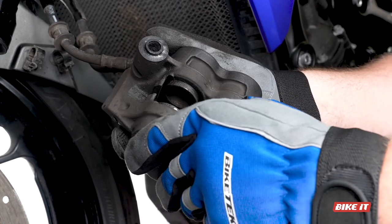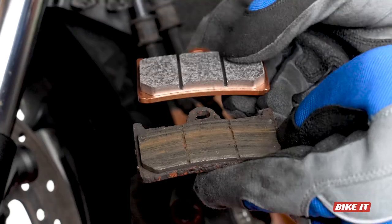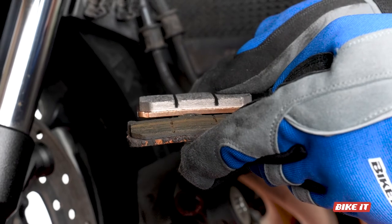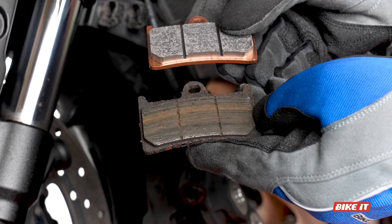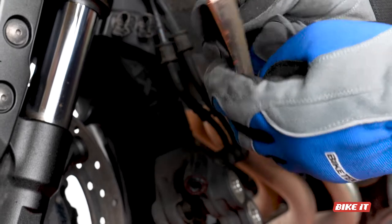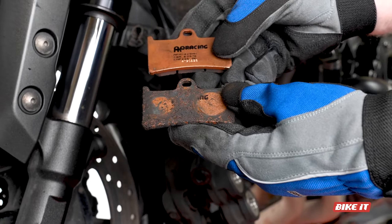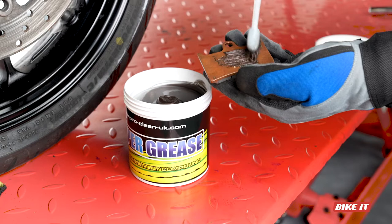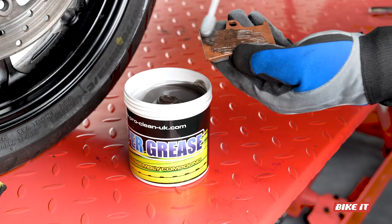With the caliper now looking factory fresh, it's time to turn your attention to the pads, bolts and pins. Visually inspect the pads — ensure each has plenty of friction material left on it, is wearing evenly, and that the pads aren't glazed or corroded, and replace where required. Spray down the pads with brake cleaner, cleaning off any built-up brake dust deposits and old copper slip off the reverse of the pads. Once happy with the condition of the pad, or if you've got new pads to hand, apply copper slip to the back plate of the pads and pins. No need to go overboard — you don't want this going everywhere and ending up on the pad's friction material or on the brake discs themselves.